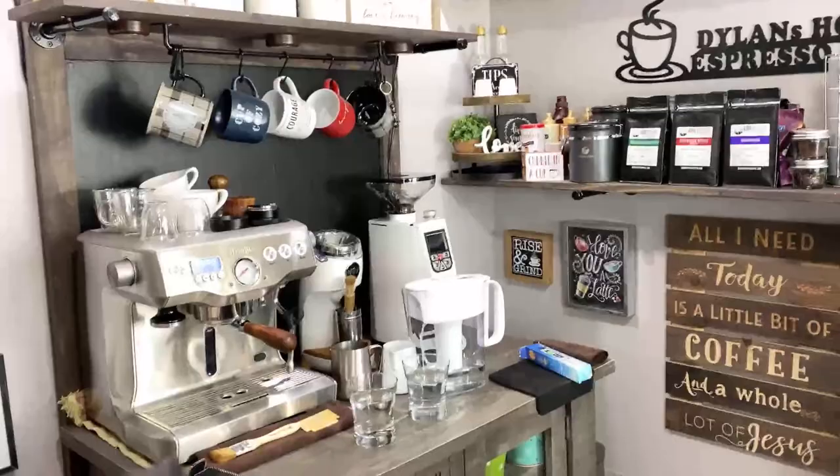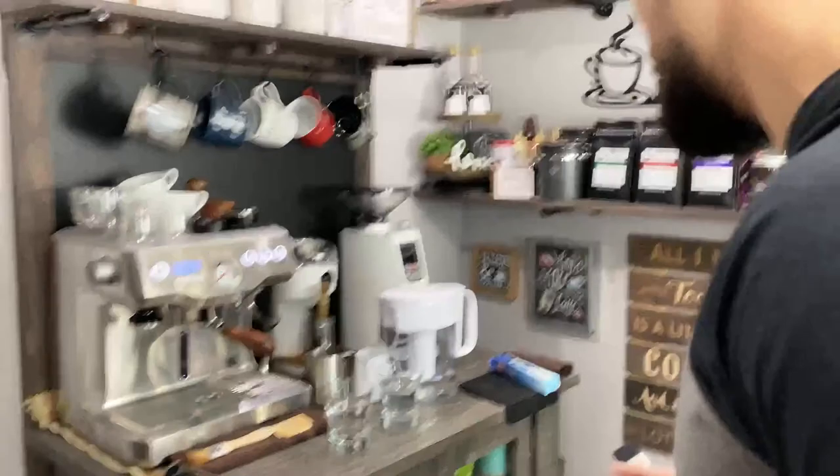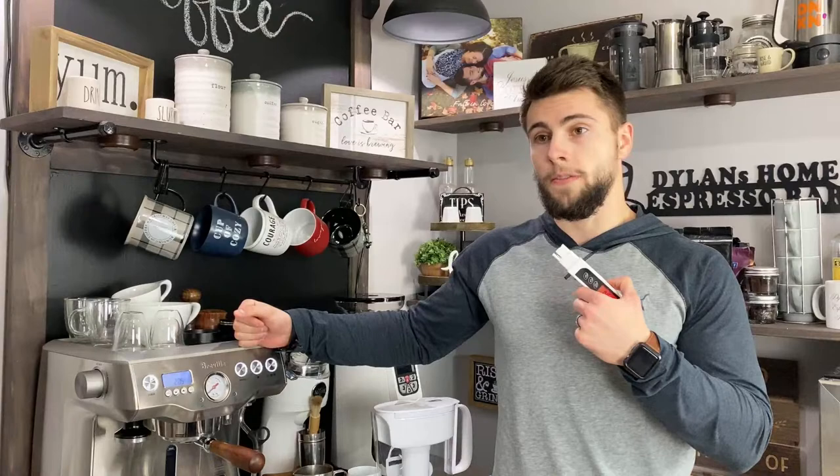So I would say stay away from descaling too often, because a lot of the higher end espresso machines, talking to La Marzocco, talking to companies like Slayer, any kind of huge espresso machine in commercial use, they actually say that you should never descale your machine. They say that if you use the proper water, filtration or osmosis water to begin with, you should never actually have to go through a descale. So they actually said that descaling is something that is really bad for the machine.